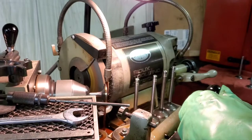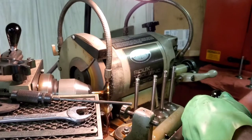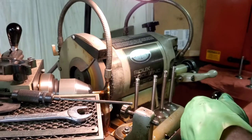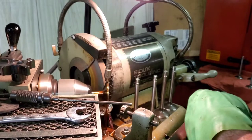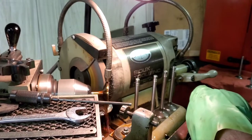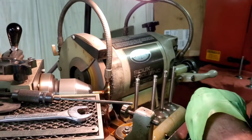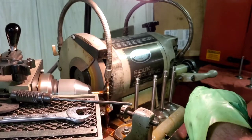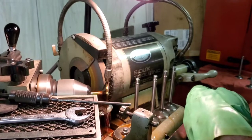Come in slowly. That one came right in — that's going to maybe take like a half thousandth. Just going to true it up, make sure all of our angles are consistently across the face with no deviation.